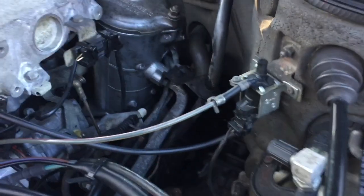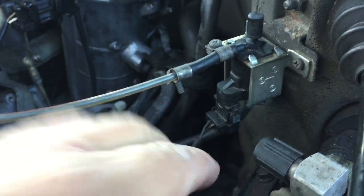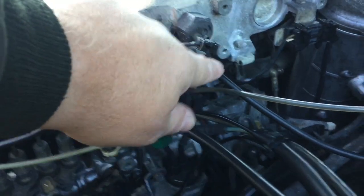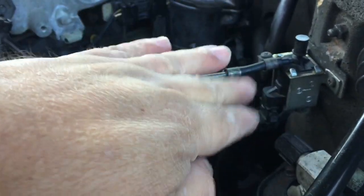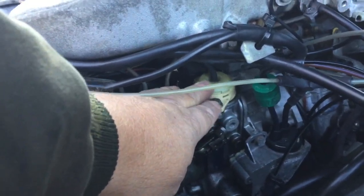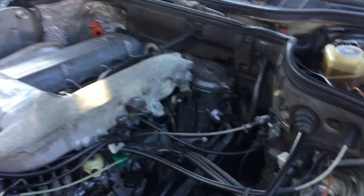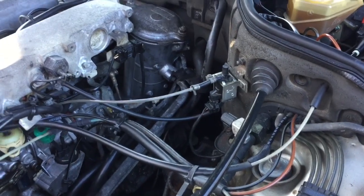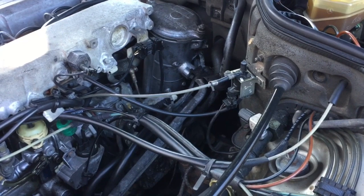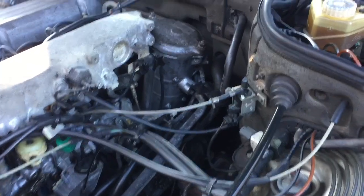And then I found another really interesting thing that I've got to tell you about, that was apparently the problem. And that is this little solenoid valve here, and how to check it. Because if this thing does not work, the boost pressure that's sensed up from here goes through the valve, and if that is not allowed to go all the way back to your fuel injection pump, because that is helping regulate how much fuel goes to the engine, it causes your gas pedal to be in the wrong position if you're lacking power, and that is causing the darn thing to jerk like crazy during gear shifts. So here's how you check it.